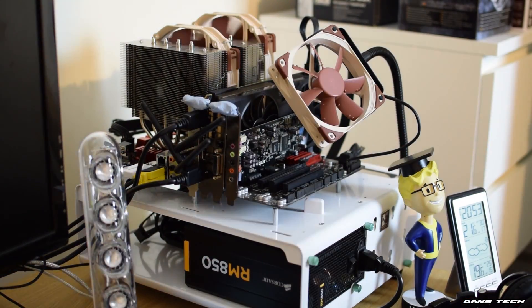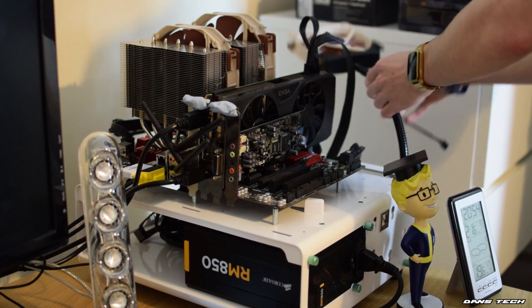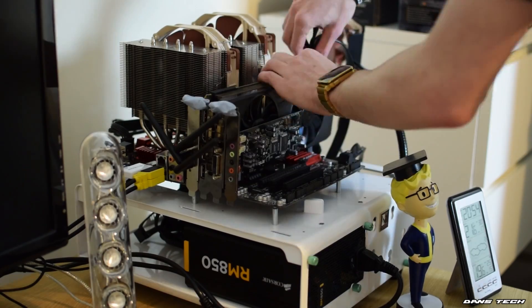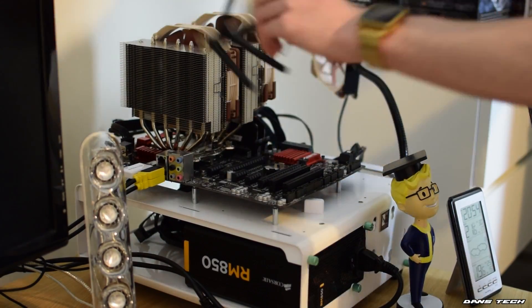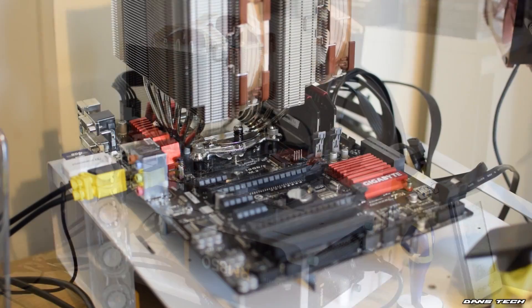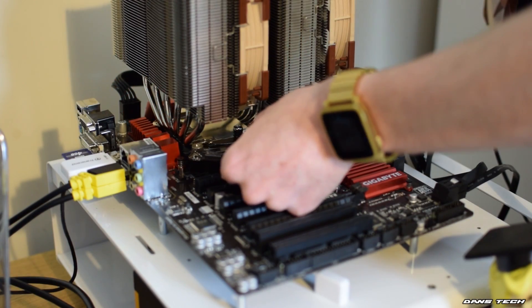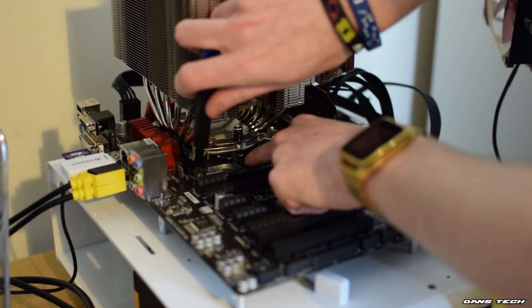On to the installation of this drive. I'm going to demonstrate plugging it into a standard M.2 port on my Z97 motherboard, and also into a PCI Express x4 expansion card. As I have an Intel Z97 motherboard, and even though it's only a couple of years old, it only natively supports SATA M.2 drives and doesn't natively support PCI Express NVMe drives. The M.2 port on my board is only 10 gigabits per second, and this Samsung drive needs at least 20 gigabits of bandwidth to perform close to 2 gigabytes per second.